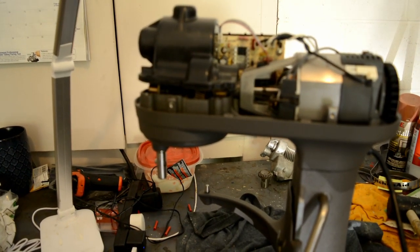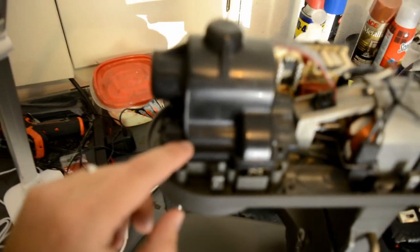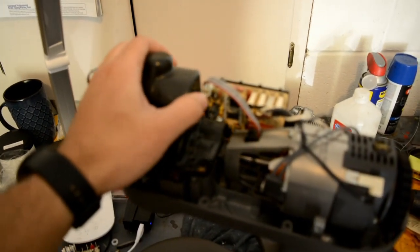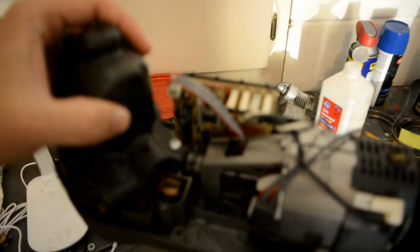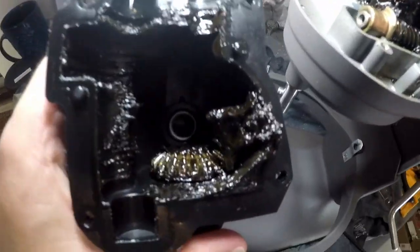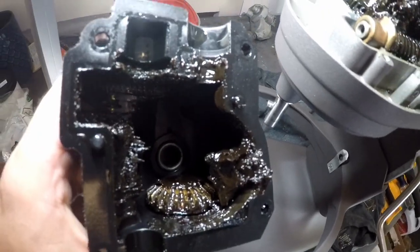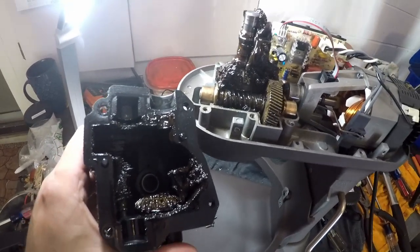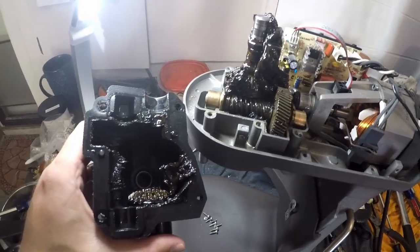The next step is to remove four screws — they are Phillips head again. Now that we've removed all of those screws, all of the ones that held the housing together and the ones that go in here to hold the transmission housing are all the same size. So if you put them back, you're not going to have to separate them — they are the exact same size. Once all of the screws are out, this actually just lifts out. I like to turn it a little bit as I'm pulling to keep it from hitting that speed control, because you can actually break the clips on that. There's a gear in the lower and another gear in the upper housing we removed, plus more grease up there. So the next step is to remove all of this grease — if you're taking it apart, you want to put new grease in so they're operating at maximum potential.